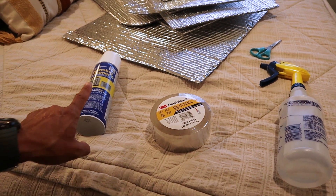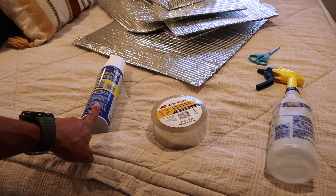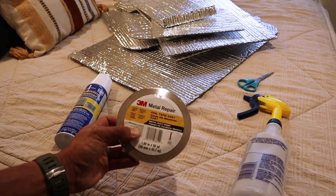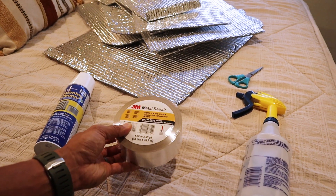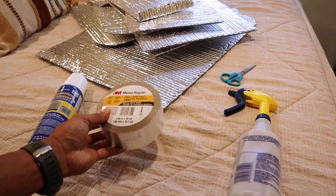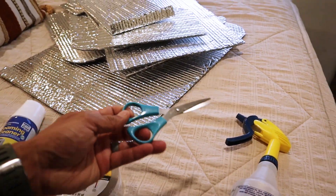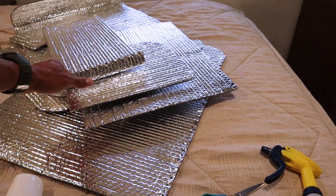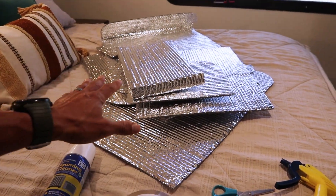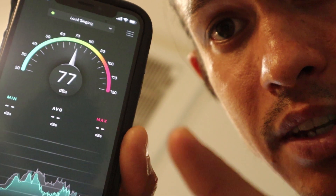For this project you will need coil cleaner — ideally one that is safe for your type of RV roof. I have a way to trap the runoff and rinse it out just with towels. You will also need AC duct repair tape — this is the foil and paper-backed metal tape, not regular duct tape — a good spray bottle full of distilled water, a pair of scissors to cut Reflectix. I have a bunch of leftover Reflectix from another project, but you can buy it in a roll from Lowe's or Home Depot. You'll also need a drill or screwdriver with a square bit.